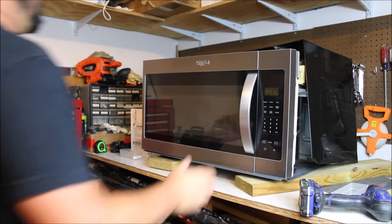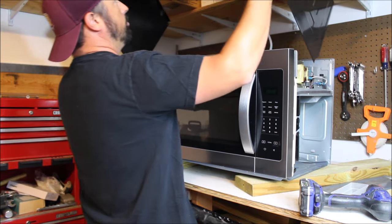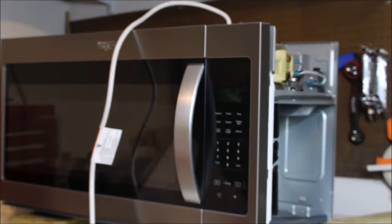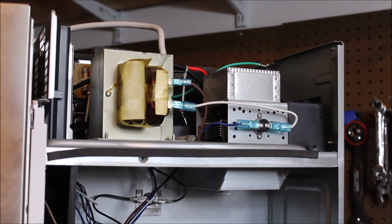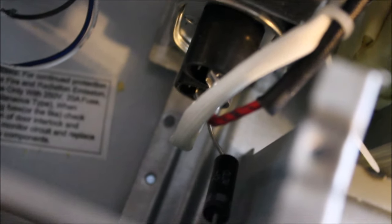To my surprise, it wasn't another screw — it just needed to be pushed back into alignment. We're going to pull this out to make it easier to work around. Now let's look at what we found in here. This is our magnetron, which is what we suspect is part of the problem. The other issue we potentially have is with our diode — that black part right there. It may be bad or malfunctioning, so we're going to replace them both since we're already in here.